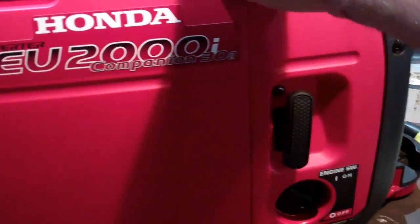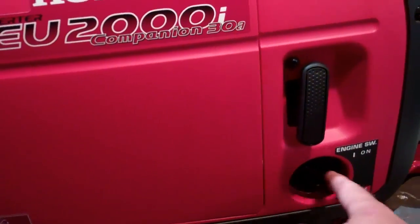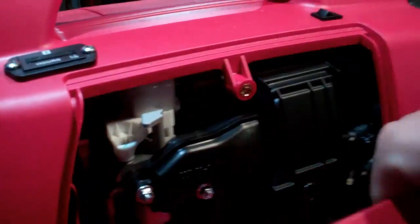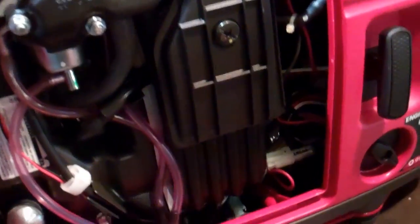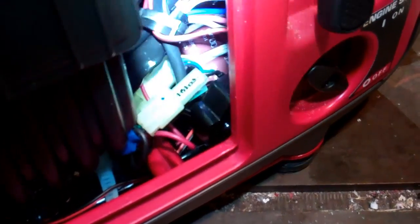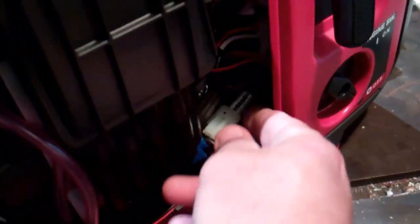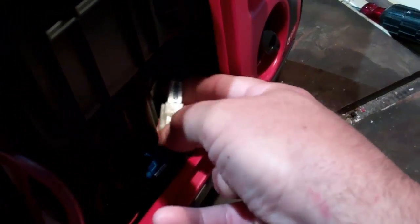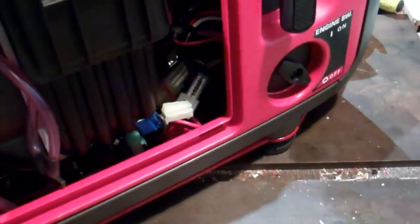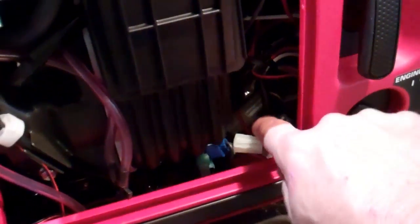So instead of putting a valve up there and leaving this on, why not just turn the valve off and let it run out of gas by disengaging the kill switch? Take the cover off, and it's a really simple fix. If you look down at the bottom, you'll see a plug, and on that plug you'll see a green and black wire. That green and black wire is the kill switch that ties in with the main switch. All you need to do is disconnect this wire, and now when you turn the valve, it kills the engine by letting it run out of gas — it disengages the kill switch so the engine kills itself.